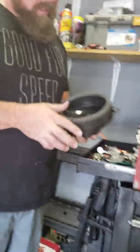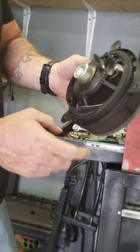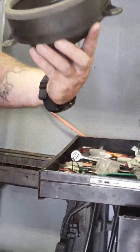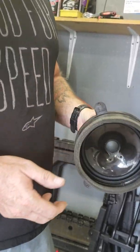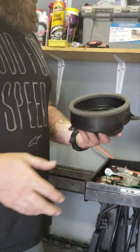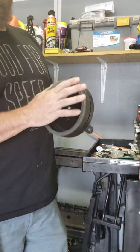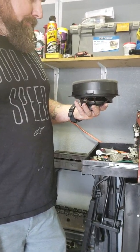This is going to be a video about my 2015 WRX. The stock standard sound system sounds like crap, most of you know that. So I am upgrading it. With Subaru, they've got these funky little plastic flanges that bolt to stock holes in the door. Most speakers you buy don't have anything that matches these, so Crutchfield makes an adapter plate. I don't want to spend the extra money or wait a week, so I'm going to show you how to make that adapter plate out of the stock Subaru speakers.